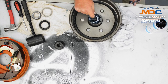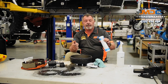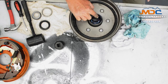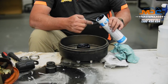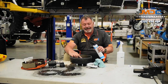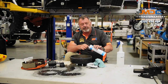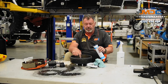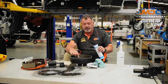We've certainly got plenty of grease in there now, so I can drop that in the hub. Now what we want to do is pack some extra grease in there — get as much in on top of the bearing as we can. While you do this, try not to get any greasy fingerprints on the drum itself, because you don't want any contamination on the linings or the drum, as that will affect your brake performance.